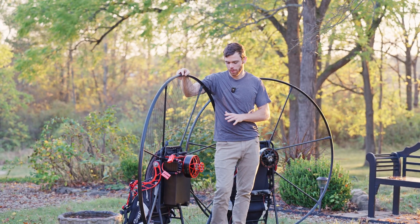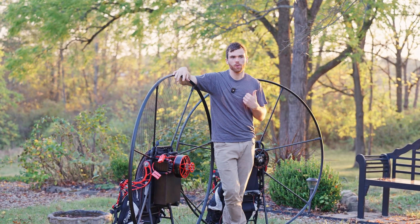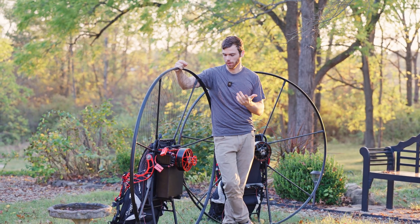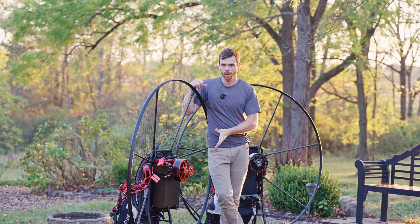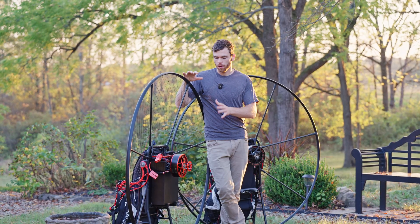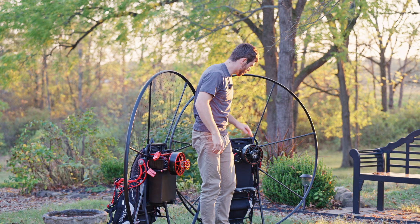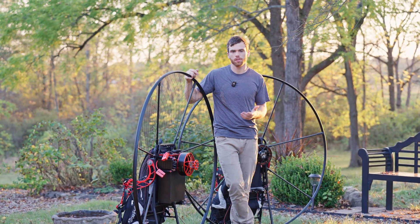So with all these systems designed to work seamlessly with each other, this allows for a better, more accurate, and more reliable experience. My goal is to make the electric system really reliable — I think it's already more reliable than gas, but with this new system it's just a huge step change in simplicity and reliability. I think it's going to be like five to ten times better reliability, just with things like the connectors, the battery cells, and the overall communication in the system. Being able to seamlessly monitor all these different sensors — voltage, temperature, any errors — anything that pops up with this new system is just a huge change in reliability, versus the old one which just looked at overall voltage.